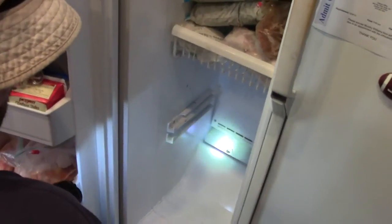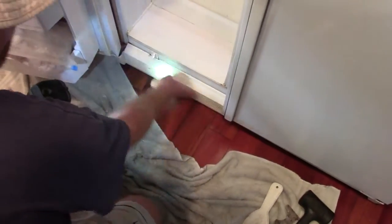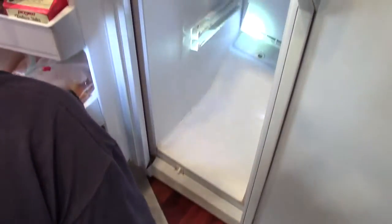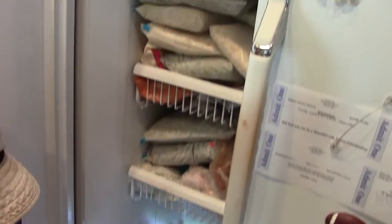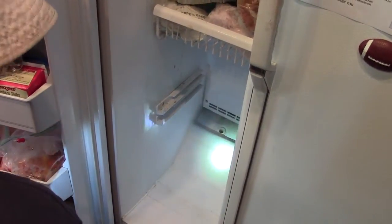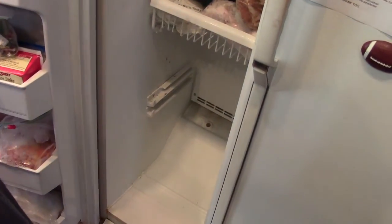That's where the leaking water comes from oftentimes in these newer refrigerator freezer units. If you see a puddle of water down here where the ventilation guard is, usually that's what it is — the drain plug is stopped up. When these units defrost themselves, there's basically a heating element back there that melts the ice, and that water has to go somewhere. When that drain plug is stopped up, it's going to go on the floor. That's as simple as it is. Okay, I hope you learned something. I'll go about putting the rest of my frozen food back, and I'll talk to you later. Thank you.